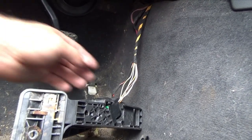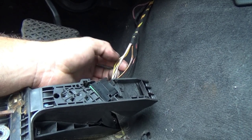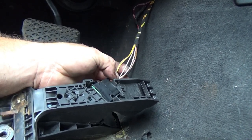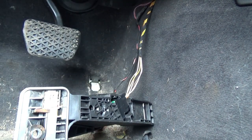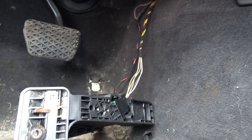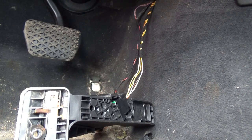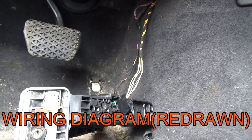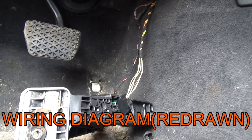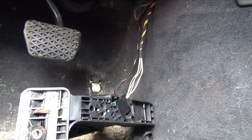I've got my wiring diagram out. The brown wires are going to be my powers and grounds, the yellow wires are my powers, and the white wires are going to be my signals. So I have a white-yellow and a white that we're going to test out. We've got a yellow-green for power and a yellow for power also. Note that AllData does not have a 323i in their system, so I used the 328i which is pretty much the exact same model.